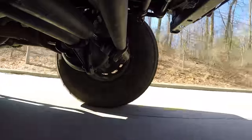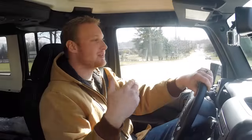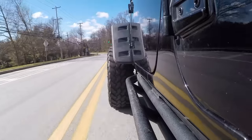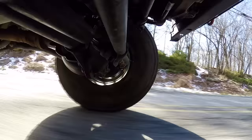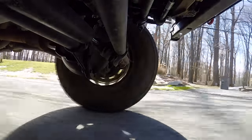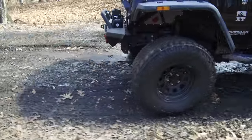These are all things you have to consider. If your Jeep is just going off-road, a 37 is going to be the better tire, giving you more clearance and easier obstacle rolling without worrying about on-road drawbacks. But for a mixed-purpose rig or an on-road build, a 33-inch tire is probably the better choice. It's also important to remember that a bigger tire gives you more clearance from the ground to the axle, whereas a lift gives you more clearance to the skid plates and frame — and those two clearances are very different.